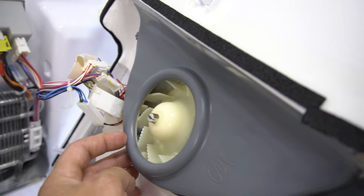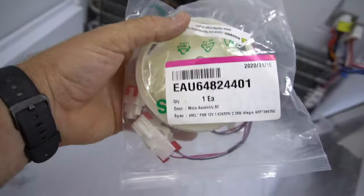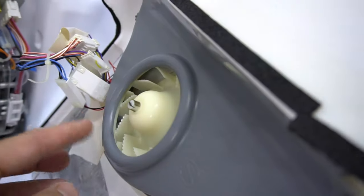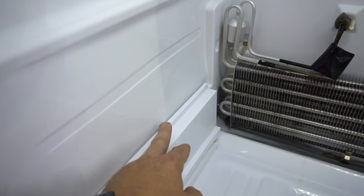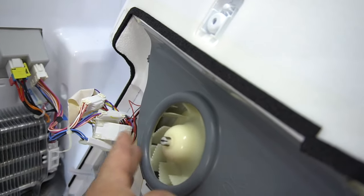This is the fan that has stopped working. Again, this is the model number for this fridge, but this is probably going to have a pretty similar part number — this is EAU64824401. It's basically just plug and play. Now if you want to do a test, just set up a camera or your phone in here, press record, close the door, and then see if this will start spinning. If it's not spinning even after two or three minutes, then your fan is not working and it's not flowing air from the coils to make your fridge cool.